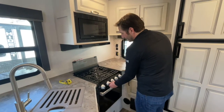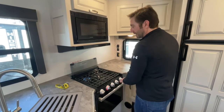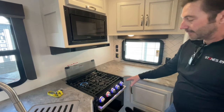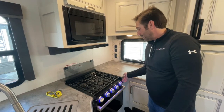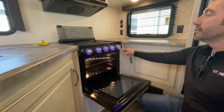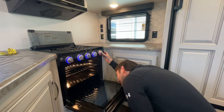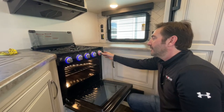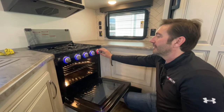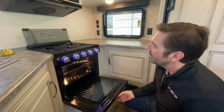To use the burners, your propane is going to be on. Turn on the set burner that you want, just give it a little click, and the burner comes on — it's a great way to get the air out of the lines. When the burner is on, you get a red light. To turn on the light in the oven, push down to number two. To light the pilot light, use the oven dial, turn it to the flame, push that in and then click. Hold it for about three to five seconds, then release — the pilot will stay lit, then turn to the desired temperature. When you're first getting this lit, it could take up to about a dozen clicks to get the air out of the line.